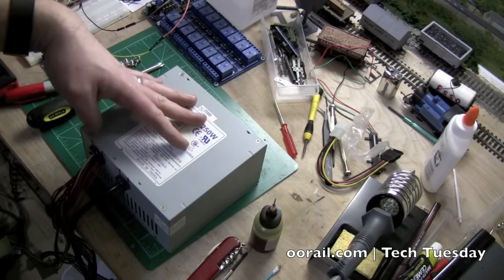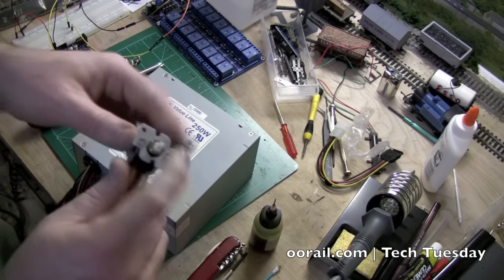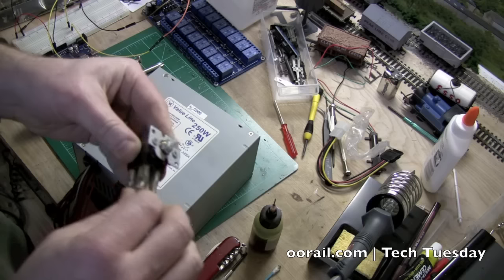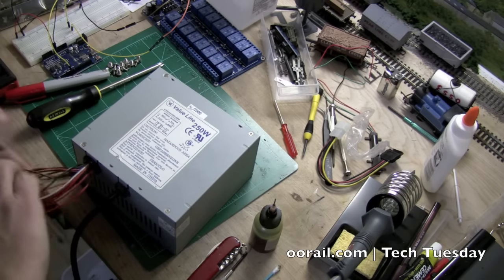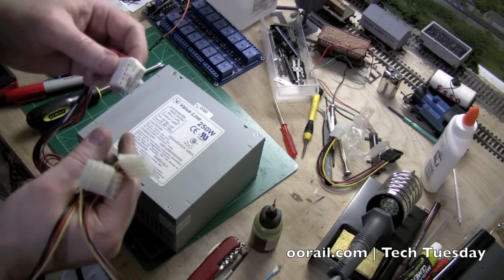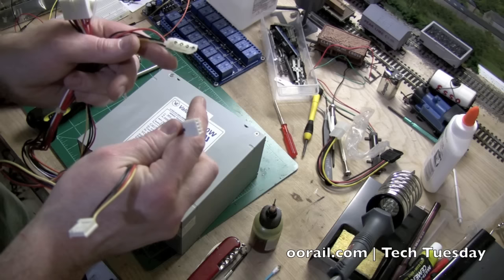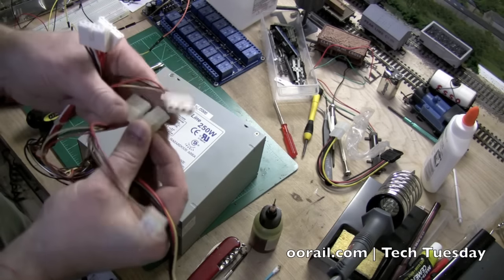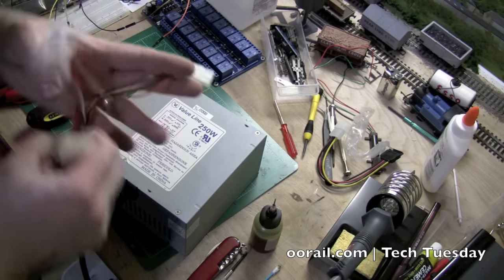So it's been reassembled and you basically have your power switch here. It's got some mounting points so you can always mount it to your baseboard or under your baseboard. These connectors — you want to make sure they're still connected properly. Now there are some connectors on this side that we're going to use and some we're not going to use. We're not going to use the motherboard connectors so you might want to just tape those up. I'm also not going to use the floppy drive connectors since there's no easy way to connect those without buying some components, so we're going to leave those alone. One of the 12 volt connectors on here should be good enough for what we want to do today.